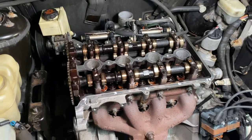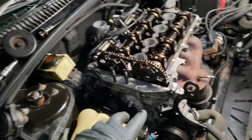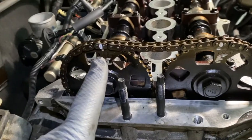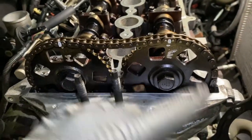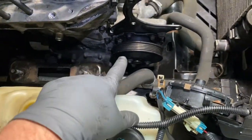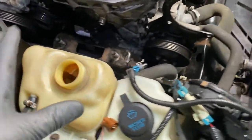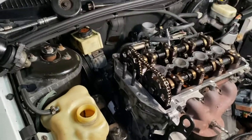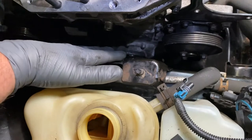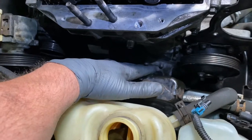And now we're gonna put the chain on. So after you line up the timing again, see, like when we took them off, everything's lined up here and here and on the bottom. Put the timing cover on. I didn't have to take off the water pump. What I did is I put the caulking on the cover itself and made the engine pretty much level, and slowly, diligently put it on, making sure that the caulking, the silicone, I mean, doesn't rub on anything.